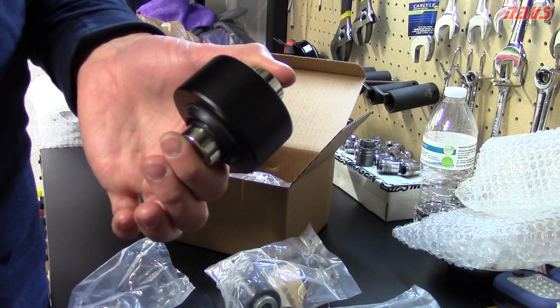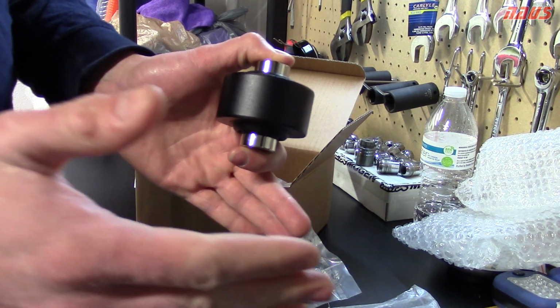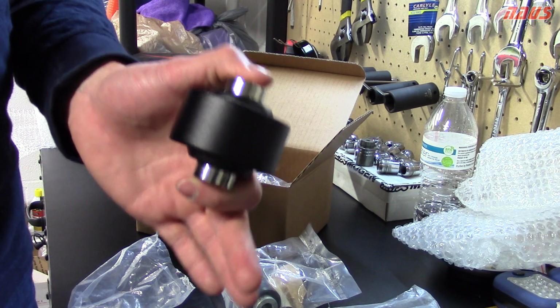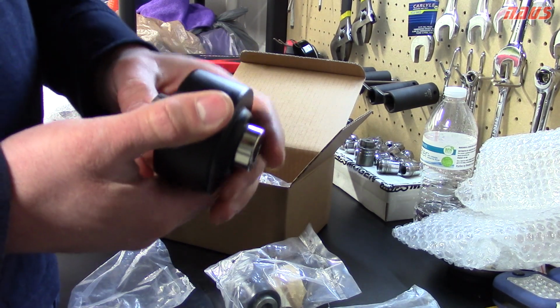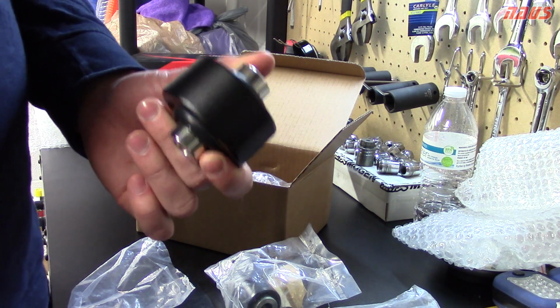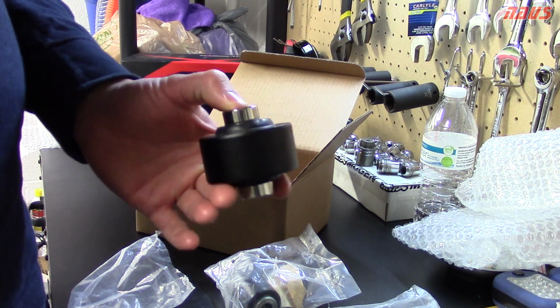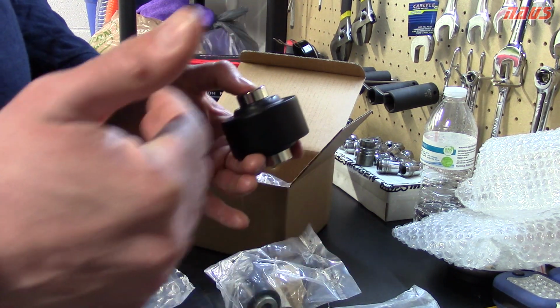So these will add a lot of vibrations to the car, and it's definitely going to be a harsher ride, but your control arms won't move at all when you launch your car or get on the throttle. And this will also help eliminate torque steer, because when you get on the throttle or launch your car, the factory rubber compliance bushings and control arm bushings flex, and when the lower control arms flex back and forth, your steering rack stays in the same spot.